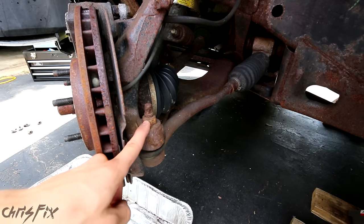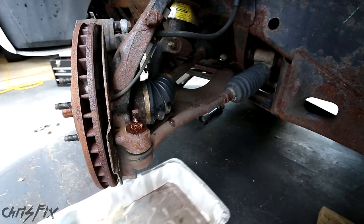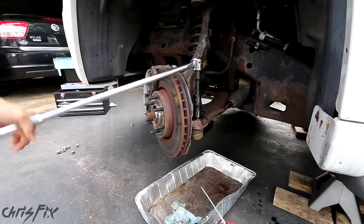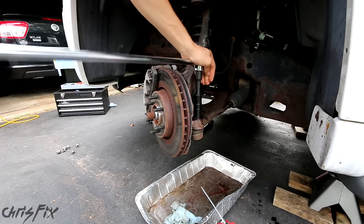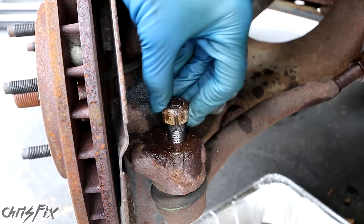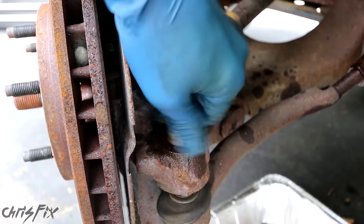Let's get some penetrating fluid on this nut here and the jam nut back there. I'm gonna be using my homemade penetrating fluid — if you want to see how to make this I'll put a link to that video in the description below. Now we're gonna get our socket — in this case it's a 13/16th — and get our breaker bar. That was not hard at all; usually that is a lot harder, but the breaker bar did the trick. Now you're gonna get your nut and screw it on the top just flush, because the next thing you're gonna do is hit the top of this with the hammer and just pop that tie rod down.